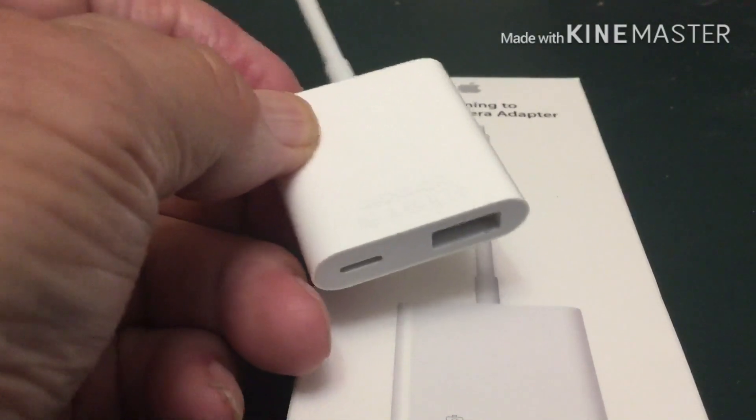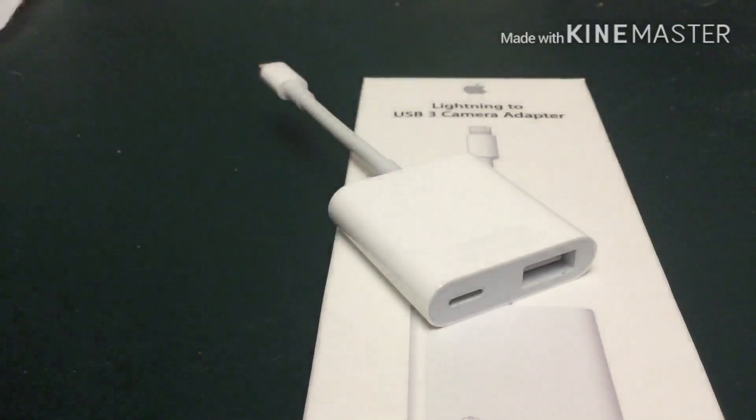Finally after trial and error, it occurred to me that the only thing that works all the time is when you plug in a power plug that has 5 volts and 2 amps of power at least. The charging adapter that comes with the iPhone is not powerful enough to run this, but the iPad mini charger is — it has 5.2 volts and 2.4 amps. Any plug that provides 5 volts and 2 amps should work with the iPad mini 4 and the iPhone XR.